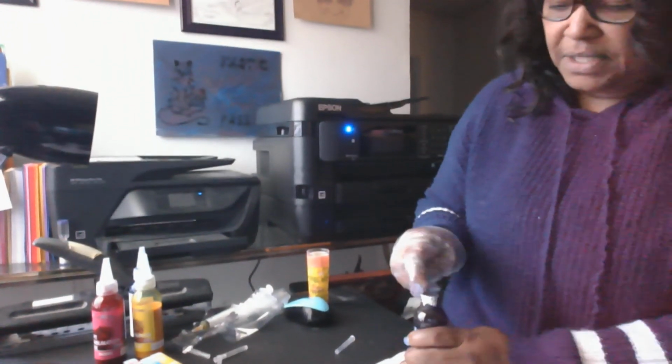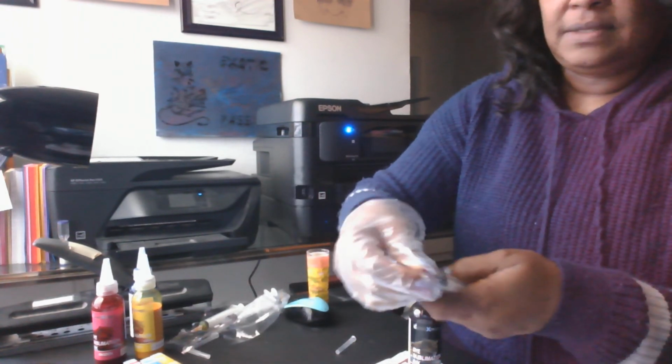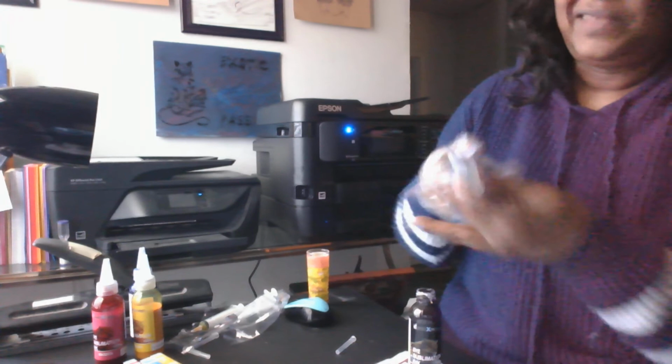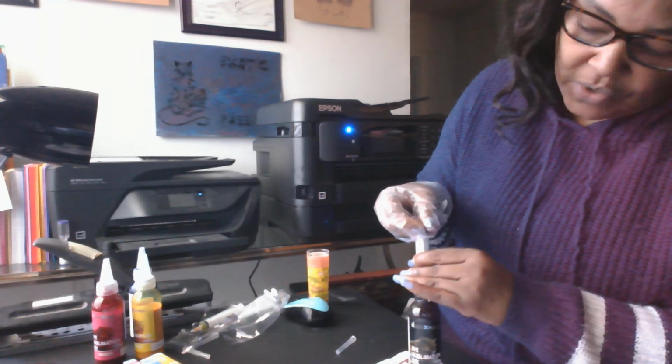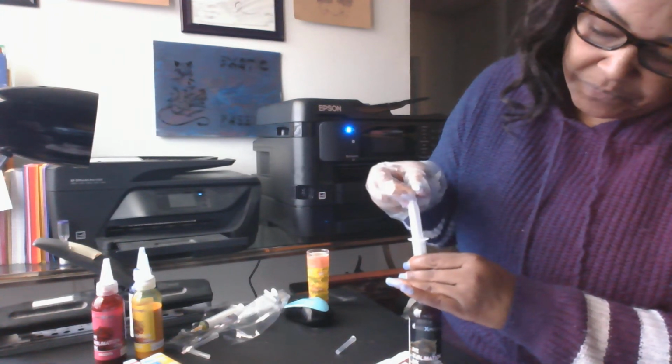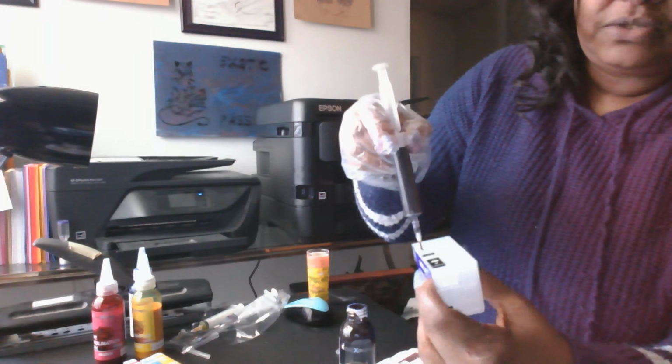All right, so for the black, they say take about 30 to 35 milliliters of ink. So it holds the most out of the sub ink. So again, take your syringe and our last needle here and pop that on to your syringe. And let's get it cracking. So we know we're going to have to go a couple of times on the black. Okay, so going into the hole that's closest to where the tab is.